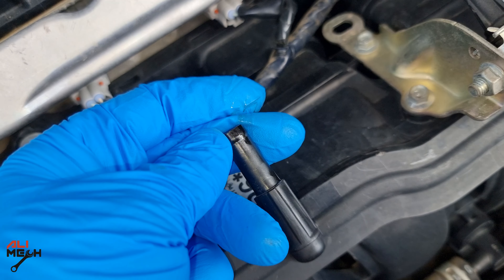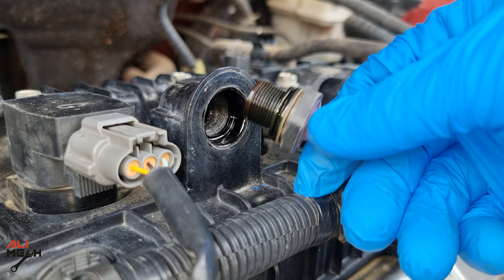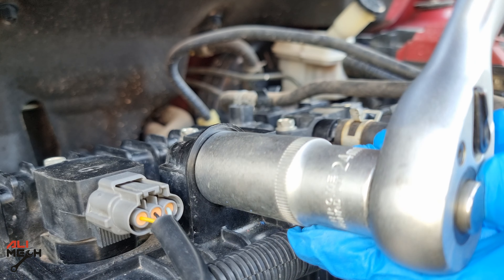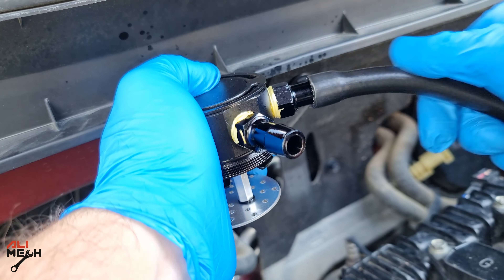Then it will pass by the filter and go back to the intake manifold. Let's remove this hose — we can see there was oil that entered the intake manifold, and we have some oil on the PCV valve as well. So it's a good time to remove the PCV valve and clean it before installing the oil catch can. We just need to spray carb cleaner and then put it back. Be careful when tightening it up — it's plastic, otherwise you will damage it.